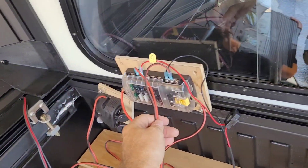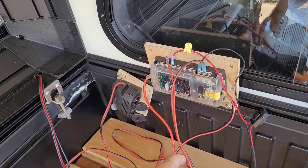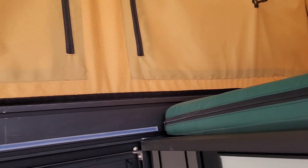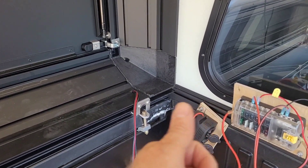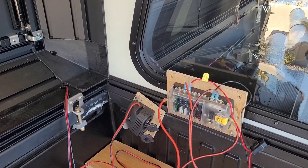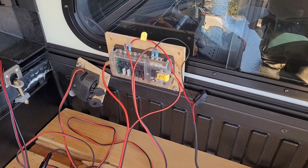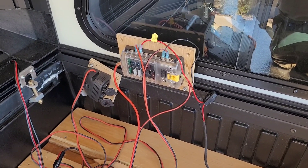So the circuit count is: one for the diesel heater, one for USB/heating blanket in the bed area, one for the MaxAir fan, one for the in-camper halo lights, and possibly a fifth for red LED lights on the gullwing doors. That's five circuits, plus a sixth for a refrigerator which typically pulls 30 to 50 watts — under 5 amps.